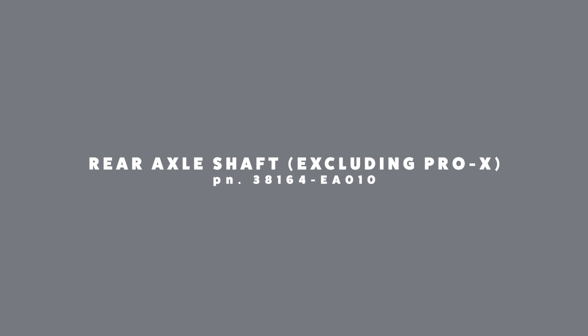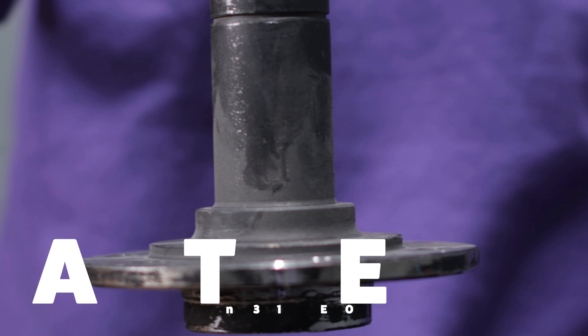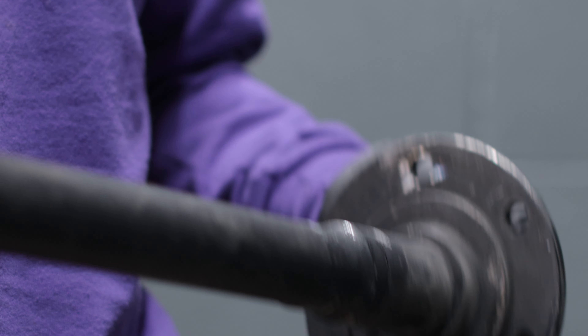What are some reasons axles can go bad on any solid axle? You're doing jumps, lack of maintenance, hitting curbs, accidents, potholes, overloading your vehicle's weight capacity. Another one is called shock loading — that's when you're burning out from stoplights, you're wheeling and stuck in the mud and just floor it, or rock crawling and you get on the gas pedal to get over a decent-sized boulder. That's shock loading and it can damage your axle. Burnouts at stoplights are probably the most common one.